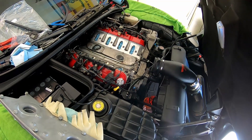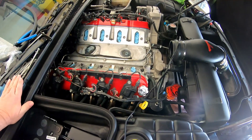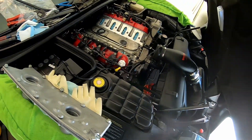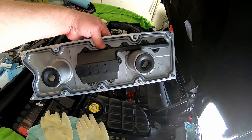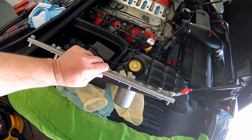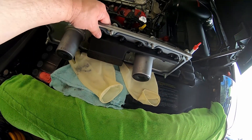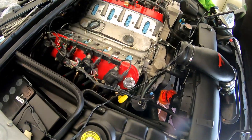I've been needing to get my PCV hoses and stuff rerouted since I made some changes, and it's turned into the battle of 'sensuous' - as in, 'since you're up you might as well do this and that.' We've got the intake manifold taken out so we can install this 2005-ish CTSV valley cover, which has a built-in PCV box and eliminates the need to run an external PCV valve.